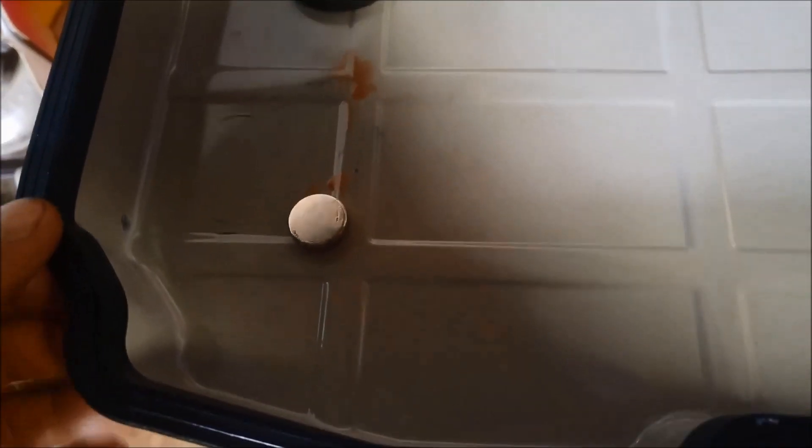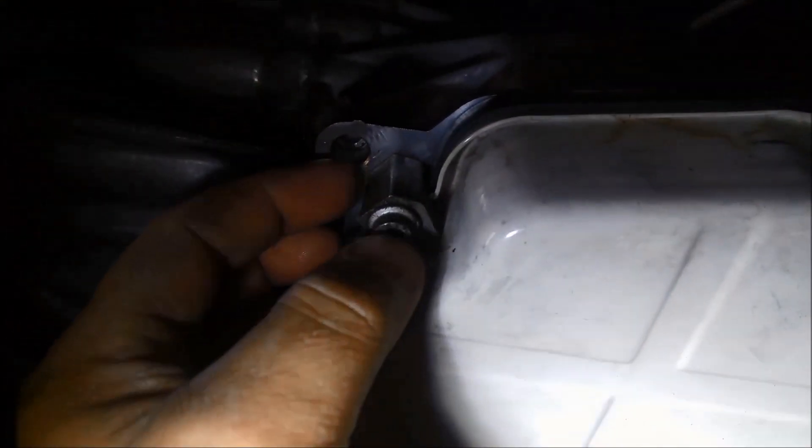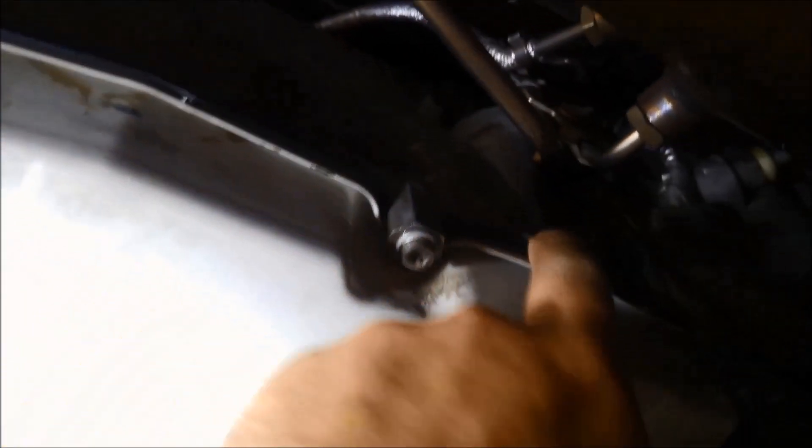As per usual, I just like to leave these magnets resting on something just so they can work underneath and on top and around — the more surface area exposed to the fine metal, the better. It had a fair bit of metal in there, so I'm just going to add one of our neodymium magnets to it as well. Also it's a good idea — the pan seal, because it's been in storage for a while — just give it a little bit of a stretch all four ways, it'll just sit on there a lot better. Heat shields back on, all nipped up. Don't over-tighten them, but these little brackets or little stops will hit up on the pan rail so the rubber's not bent out of shape when you do it up. Also when you're putting that pan on, just try and center it forward and back, left and right, just so it sits evenly all the way around.